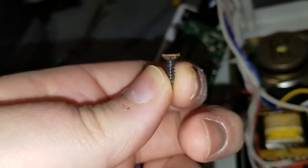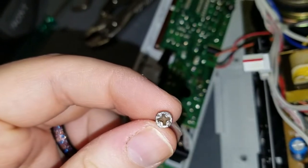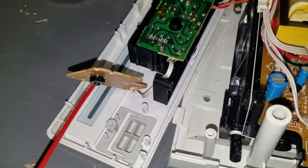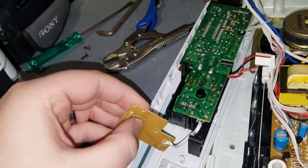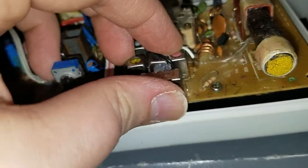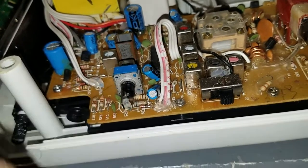Look at these screws — they're fine underneath, but on top, wow, they're nasty. I'm going to hit those up with a wire brush quick. There, that's looking better. Three screws later, we're in. Now I just need to spray the crap out of that switch and work it while it's wet — spray it and then work it a bunch to work the cleaner in. Same thing for the AM/FM switch. And I'll hit up the volume control too — even though it's working fine, just for preventative maintenance.